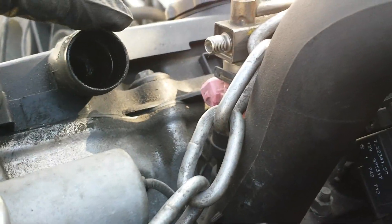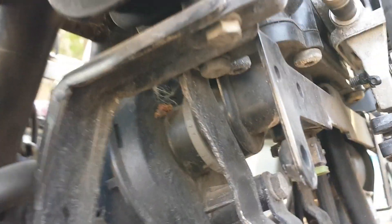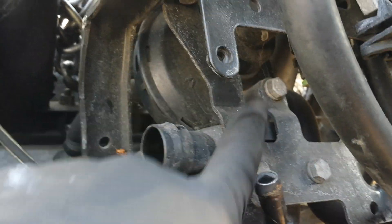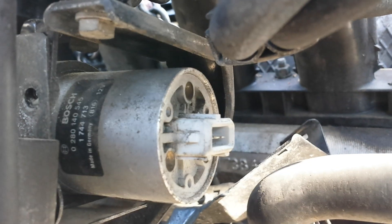I had a tube here that goes out and connects to the oil separator. The oil separator is connected to the intake manifold — I can see two torx bolts there. To remove it you've got to take those off. And of course we've got the idle control valve, the most neglected part, along with the fuel lines here.